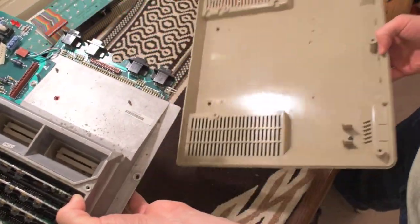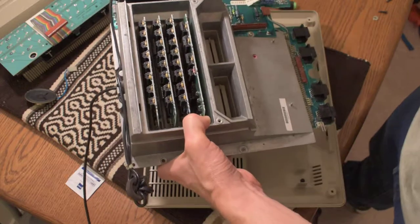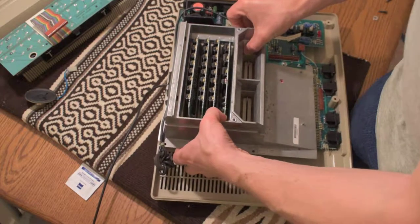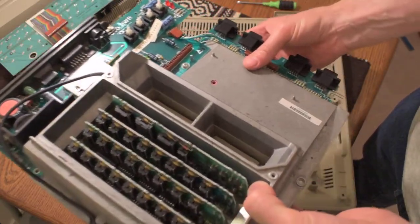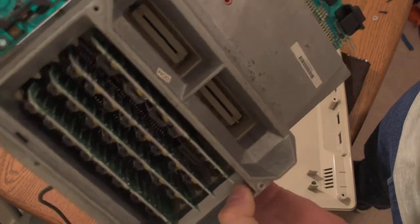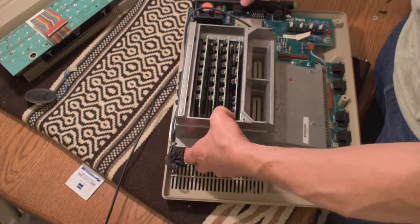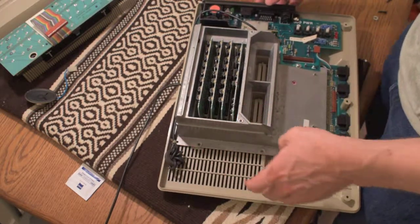Alright, I've wiped the bottom part of the case, and the top is clean. I just used water and a plastic, bristly dish scrubber. I can see joystick port 4 has pins missing on the backside. So there's something seriously up with joystick port 4 again. Why is it? This is my second 800 with problems with port 4. I know, but I think people connected their modem to port 4 or other devices use the joystick port 4.